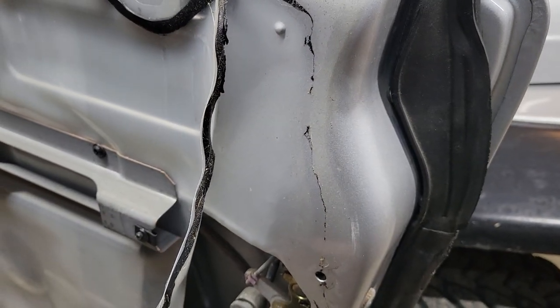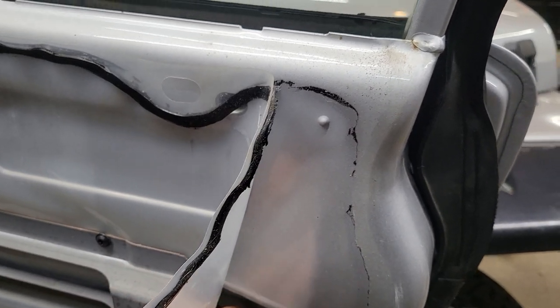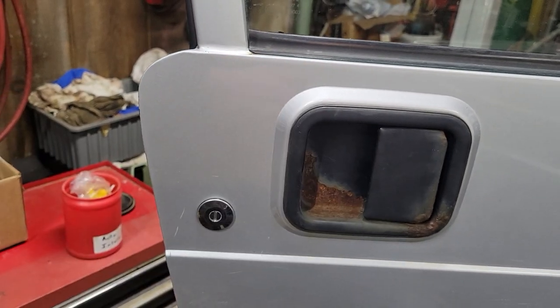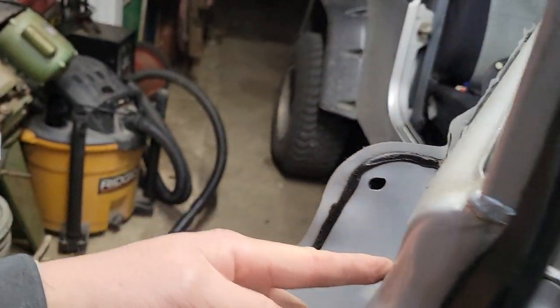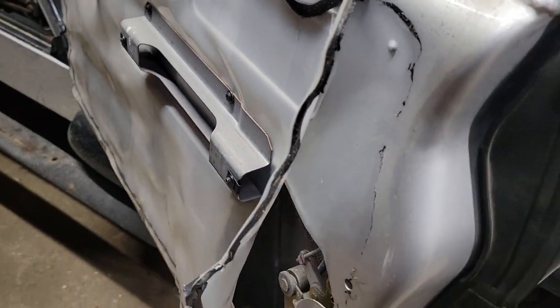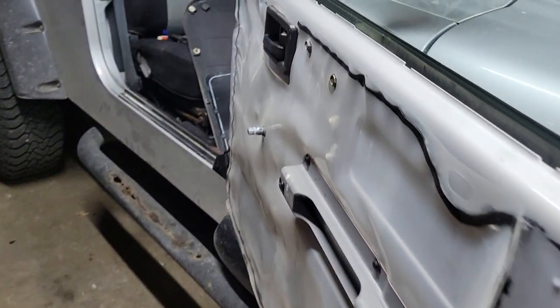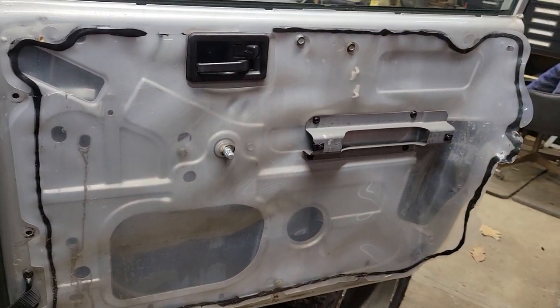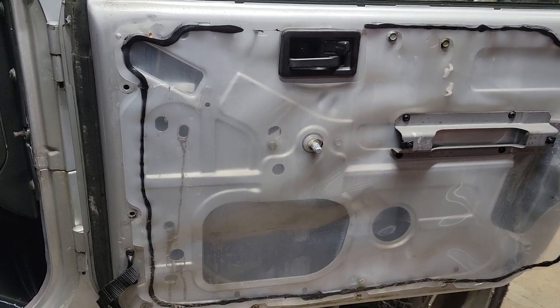So I think that's about it. Those wedges are the most difficult part — there's not really room to work from the top because you've got the glass in the way. I suppose you could take the whole door apart and get the glass out and it would be a lot easier, but I was able to do it without taking the glass out. Once you've got those wedges out, this whole thing just slides out of the door. It really is pretty simple — the new one slides in, put the wedges back in, reattach the rod, start sealing things up. Be a little bit patient. If you're getting frustrated, just walk away from it, take a breather, do something else for a little while and come back to it. It doesn't pay to get overly frustrated and break something.